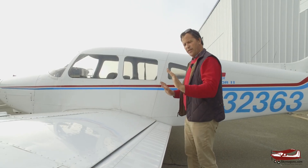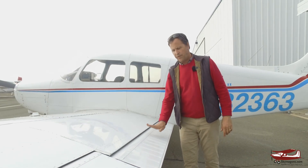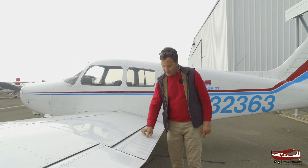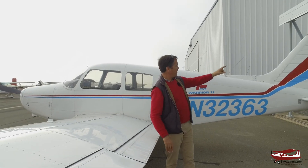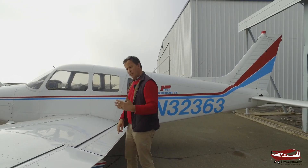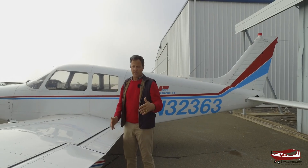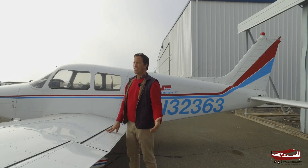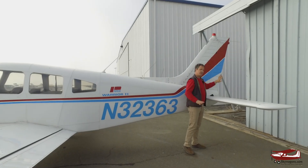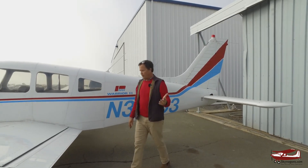So control surfaces on this Warrior — remember, this will be the same as a Dakota, the same as an Archer. Piper have these indents in the flaps and ailerons. If this was a Cherokee 140 or 160 with the Hershey bar wing, the bumps on the control surfaces and the vertical fin, rudder, and horizontal are all indented inward on post-65 planes. On 65 and older, they're dented outward. In 65 during the transition, some are in and some are out, but by 66 they're all in. I once had a 64 that had out-dents on its tail but in-dents on its rudder — with no damage in the logbooks — because the rudder had been changed to a later one.